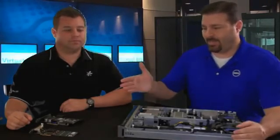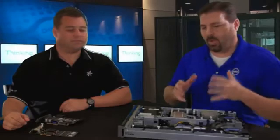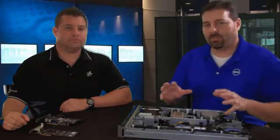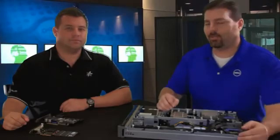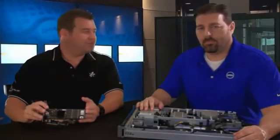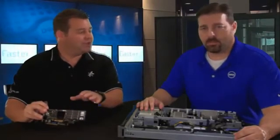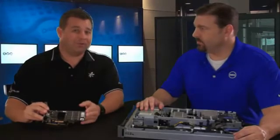We've talked about the PCIe technology and the NAND flash technology, but it goes beyond that. Fusion IO also has specific software features that make this value proposition even more compelling. That's exactly where the true value proposition comes in — the software. It's all commodity hardware, differentiating us from a true SSD. The software residing in our controller removes those disk protocols that are inherently latency-laden and a bottleneck for the disk drive. By having the CPU talk directly to the NAND flash, we achieve not only high IOPS but also remove those latencies for application performance.